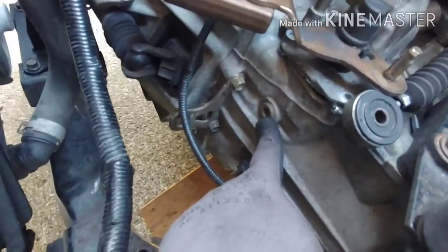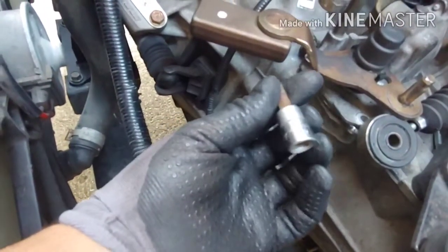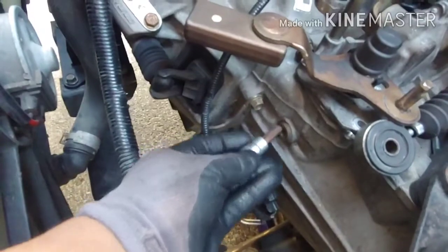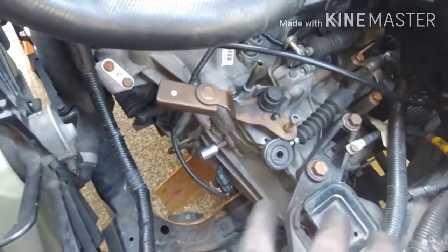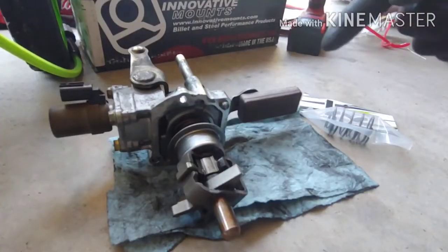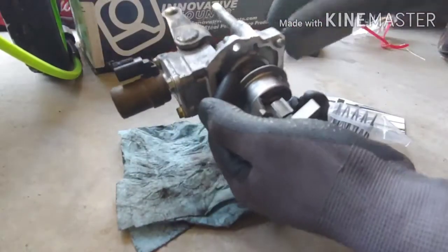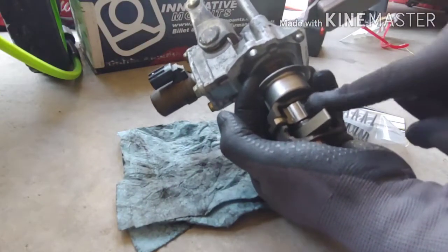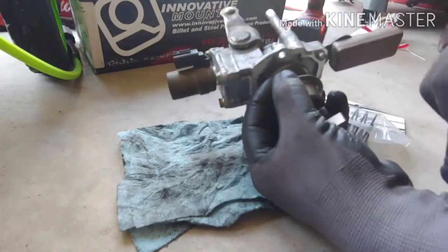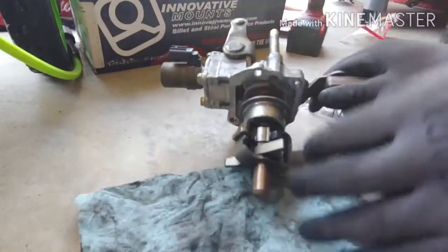Correction, on the shifter selector spring, there's four 10mm bolts around, and then you have to remove this, what size is that? Oh, it fits in there. Get that out. Should be able to release it, and then you should be able to change out the springs, which is fairly easy. So after watching some videos, I found the trick is to hold this in place or compress that, because it's going to want to spring out. Remove the bolt, has a washer on it, pull that out slowly, and then change out the springs. So let me do that in a second.